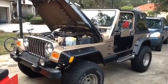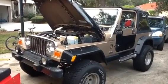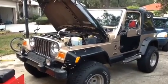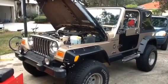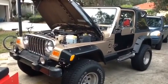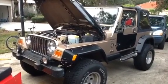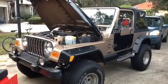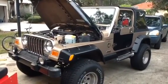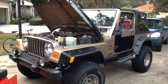A lot of people every year, when they're opening those radiator caps, wind up getting burned. Sometimes they try to turn it just half a turn and let it hiss for a while and let the pressure off, and then they open it the rest of the way. But on any given day, when you're opening that thing, it's very possible it'll just come flying off and spraying hot steam and water all over your face and hands and burn you pretty bad. It happens to people every year, so just make sure the car is completely cooled down before you begin this project. So what we'll do now is we'll take a look at the tools that we'll be using.